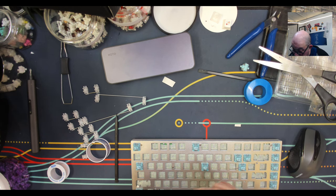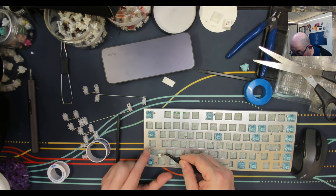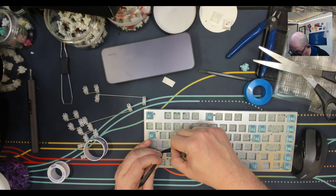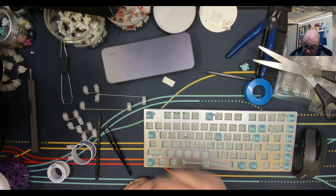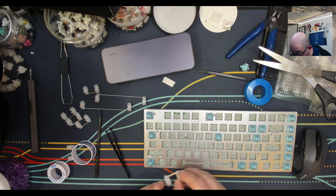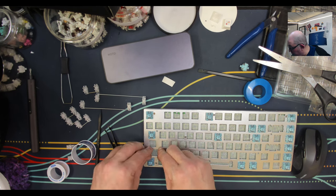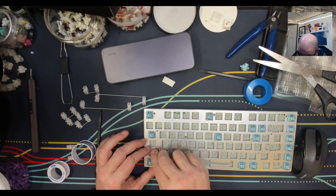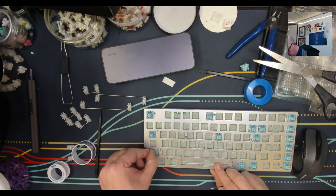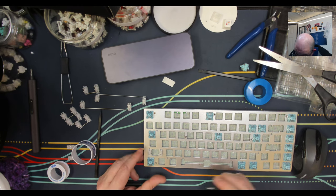All right, let's do the same thing over here. And we're doing it on the opposite side of where there's a notch. Right, just pressing down on it usually will help it stick. And go ahead and grab a stabilizer. Wires in first, and then down. Then we want to make sure that these clips are pushed all the way out so that they are attached. So now we can see that these stabilizers are nicely in place.